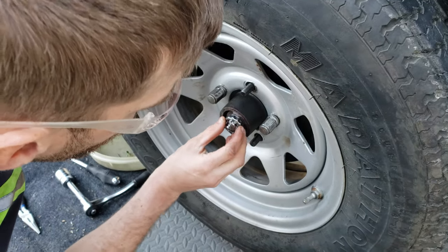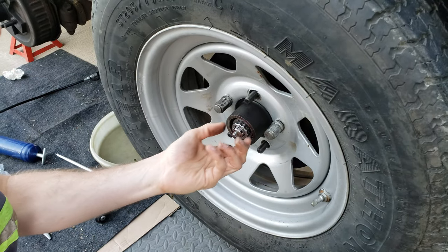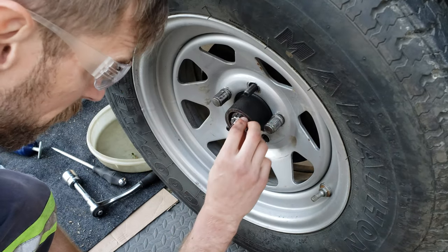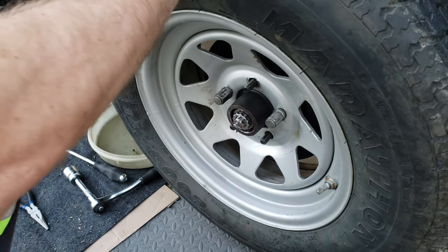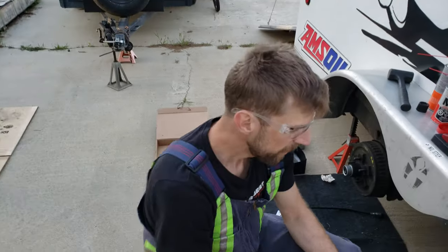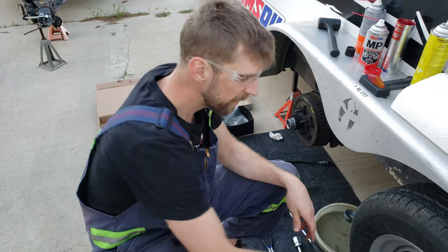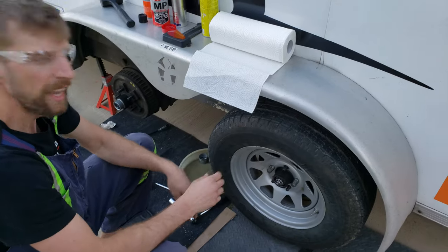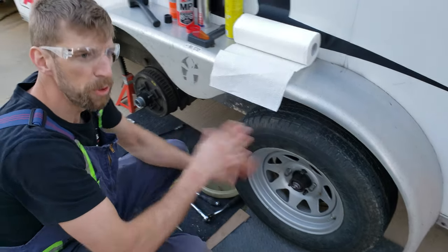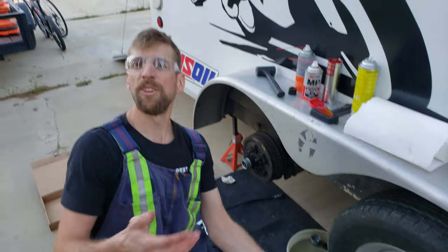This one comes with a cover and you want it to line up with the cotter pin. If it doesn't line up, back it off slightly. You want to run it loose — that's the whole point. That's probably why my wheel flew off: I took it to a shop, they put it all on and did it too tight. They tightened down the bearings and that outer race burned right up. Once the race starts to go 300–400 Fahrenheit, the bearing disintegrates, then the bearing flies off and the wheel just slides off — there's nothing to hold it on.